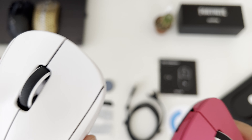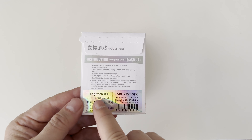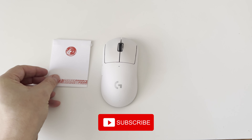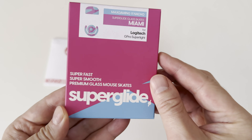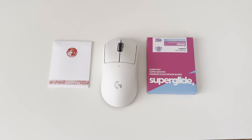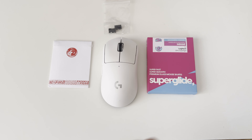First let's start with the accessories we are going to need. I am expecting that the PTFE feet at the bottom of the Logitech G Pro X Superlight will be destroyed while being removed, so I have bought fairly cheap new skates from Esports Tiger. Make sure you hit the subscribe button if you are interested to see installation of Superglide mouse skates in Miami color, designed in cooperation with Nacho Customs, who is well known in the gaming mice community for his artwork on gaming peripherals. If you know how to do soldering, you can buy exactly the same switches as installed by default — Omron 10 million clicks switches.